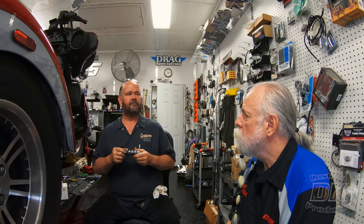This particular cam is the 818H. It's a 475 lift. It is his smallest cam, but this thing will sound great — especially on a 114. We could put a little bigger cam in this bike being a 114, but I really like this because it is a torque monster. We typically see torque in the 130s and horsepower right around 110 on a 114. Horsepower means nothing on a Harley — it's all about torque. This cam comes on hard around 2,800 RPMs, so when you're cruising down the interstate and you need to pass somebody, you just roll on the throttle, and it's like having a passing gear without ever downshifting. And probably the thing that impresses me most is how hard this thing loads for a 475 lift cam.